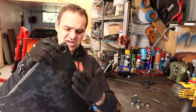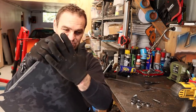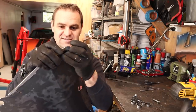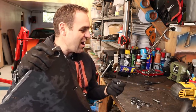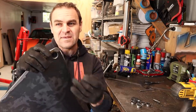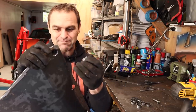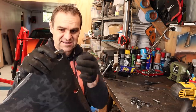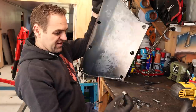from underneath, so that I obviously don't want the bolts hanging down any lower than the bash plate. I didn't want to just bolt through this bash plate, because then you're creating a lower point. So I wanted them recessed. I could have done it lots of simpler ways. I wanted to keep it a reasonably large size, because it's going to be under the car. The potential for corrosion is higher, so I'm going for M8 bolts, and I wanted the head of it recessed in up underneath, so that's why I've got this stack, and I cut all of these out.